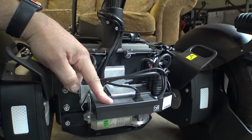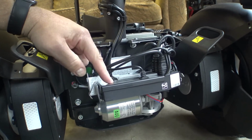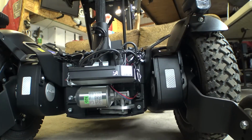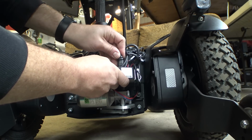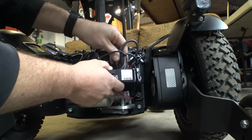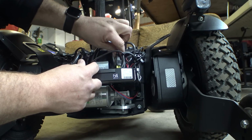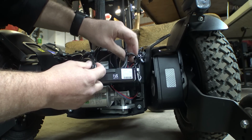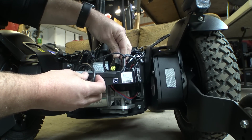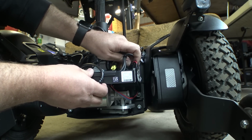I'm curious if they have different mounting for that Connect module or whatnot than they used to. Let me pull this ICS box out of here and see what we're looking at. So chair's off. I'm just going to unplug all of these RNet cables. And the nice thing with RNet and also the ICS stuff is it doesn't matter which port you use. So unplugging all this and then putting it back in really doesn't matter. Same with the ICS cables. These little flat 3-pin connectors, those can go into any port on the module itself.